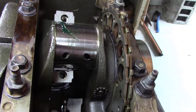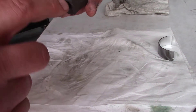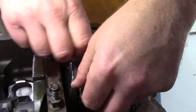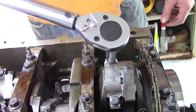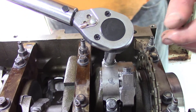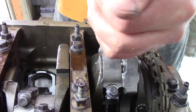We'll go ahead and lube up our bolts here. This one goes on number seven — I just numbered the side that number seven's on. At 45 foot-pounds of torque with the ARP lube it gave me the correct plastigage spread, so the bearing clearances are correct at this foot-pound value. For my application this worked real well. So: 25, 35, 45.